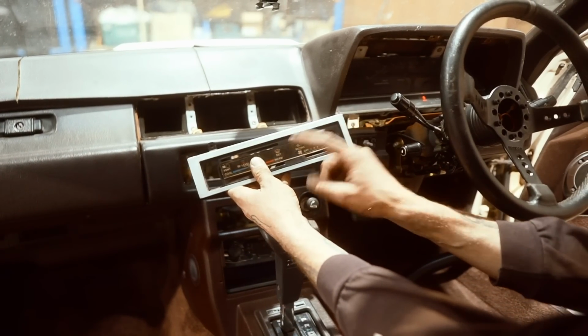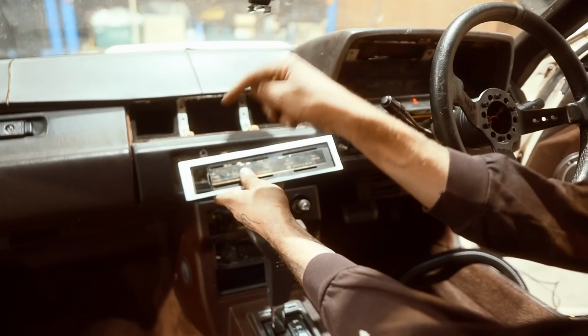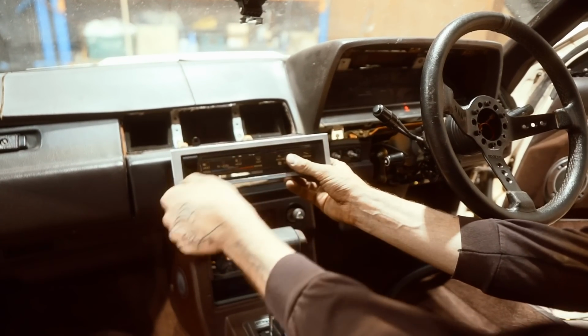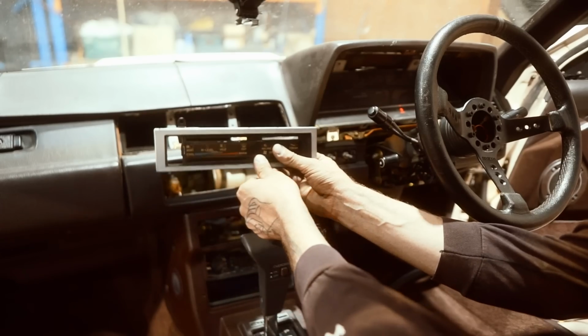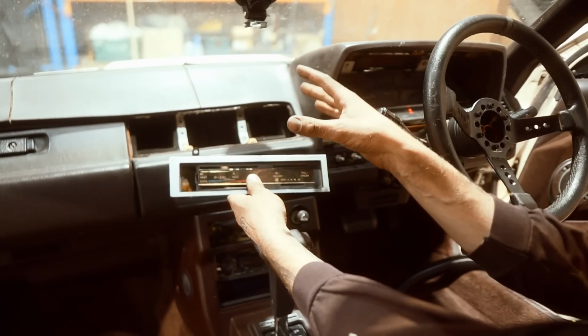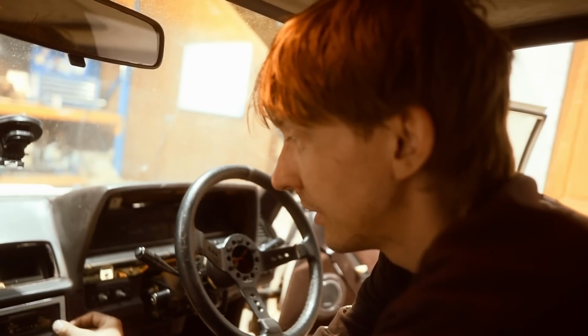And all I need for a roadworthy is for it to be set up so that the direction of the flow is always to demist. And then I'll just have a mechanical heater valve so I can open and close the heater valve. And then I'll get that to control the electric fan. And then I don't have to use any of the vacuum controlled standard HVAC system. And that'll just go in there and it'll be like a KE.